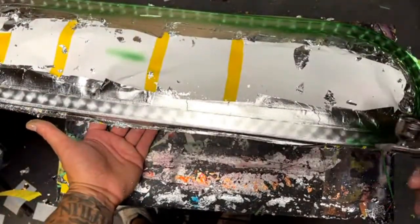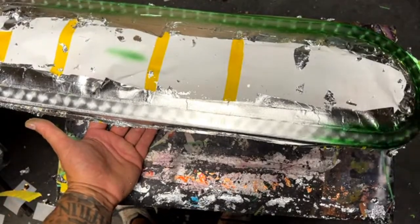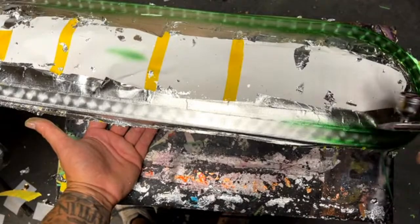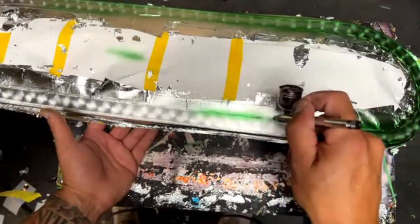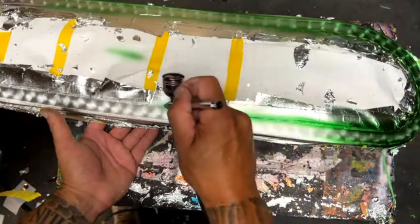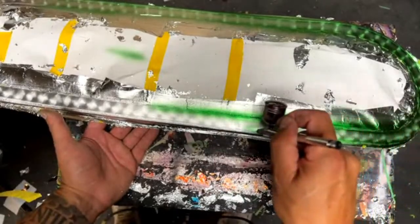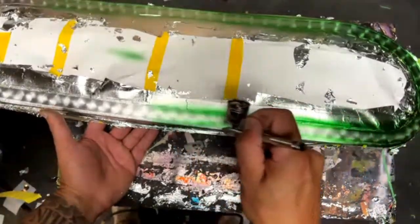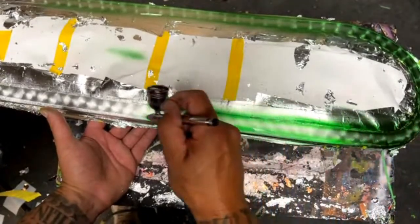And you can make it darker green, right? Yeah, you can make it darker in a couple different ways. It's transparent, so you can add more coats, which is going to darken it up, or you can darken up the mixture itself by adding more candy, which is a concentrate, into the clear coat mixture, because there really are no hard rules with that.